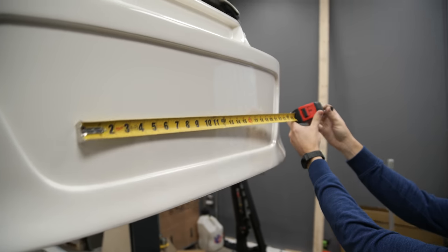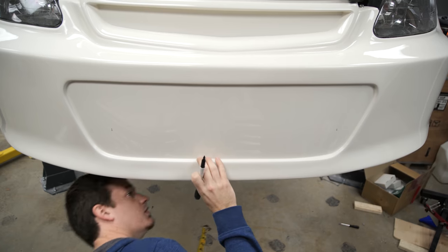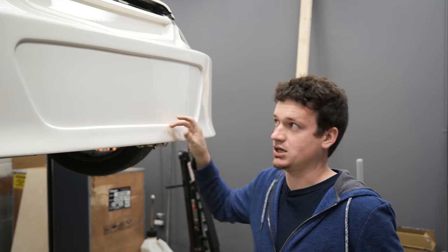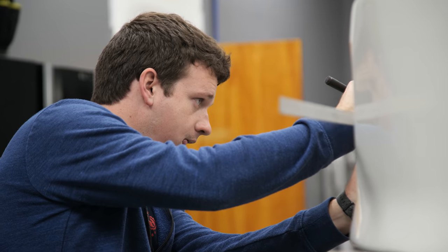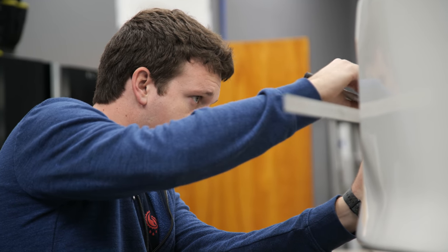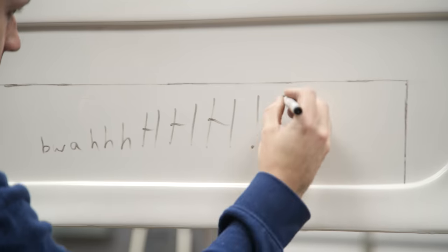Now that we have the bumper on and painted, we're going to cut it up. I don't have any ducting for my radiator cooling, which I do need. I ordered this specifically with these holes not cut out, because I'm not going to cut out the standard hole size. I want to keep drag down, which means the smallest opening possible. A rule of thumb is about one-third of the radiator core size, so I'll measure the square inches of the radiator core and that would be the size of the opening.